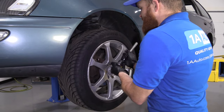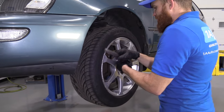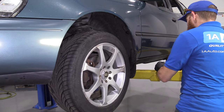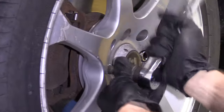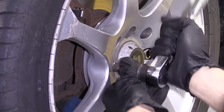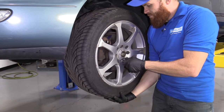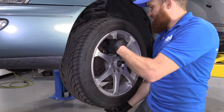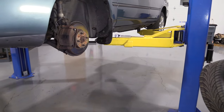I'm going to take off the lug nuts. I'll take out the first two, leave the third one in a few threads, and then fully remove the last one — I'll show you the reason why when we get to that point. Then I'll put down my tool, hold the wheel so I'm safe, lower it down, and set this aside.